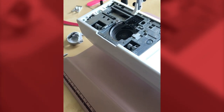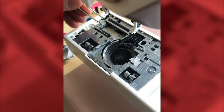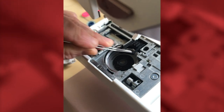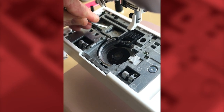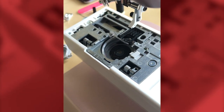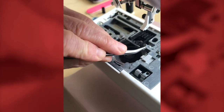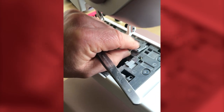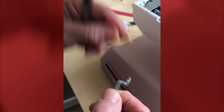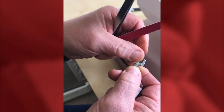Once that's done, look at the cutter mechanism. Move the fetcher — this part here — across to the middle. Note that as you do it, another fetcher comes forward too, so two fetchers come forward together. That exposes the knife area. The knife is just here, so take out this front fetcher — it simply lifts out. Look for any damage around the hook at the front; a needle may have hit it at some point.